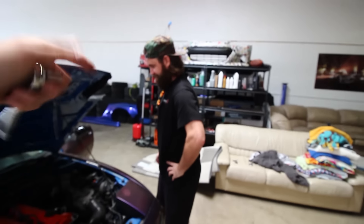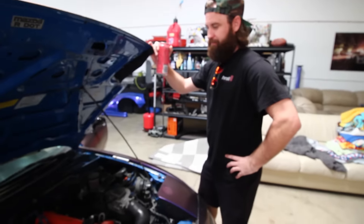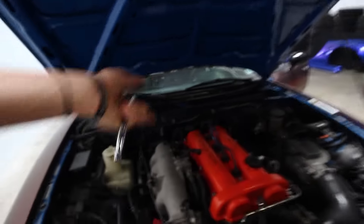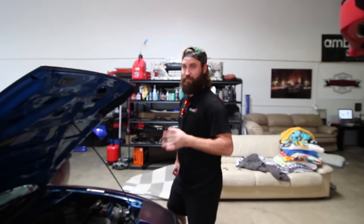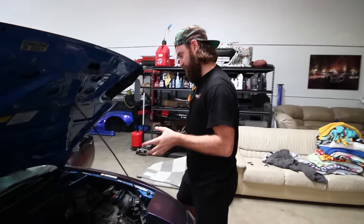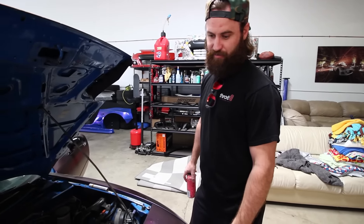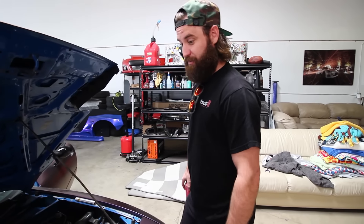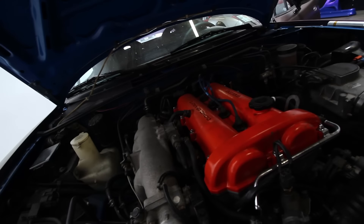Mickey over here — the bearded god, you guys know him from a previous video — was looking at some threads last night on the Mazda MX-5 forums and he thinks it's the idle control valve. It has been a problem for other people. The problem you're having seems to be a very common problem with this year of Miata. So we're gonna start with the idle air control valve and see if it's got the upper O-rings replaced.